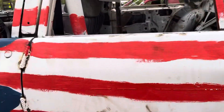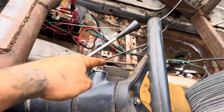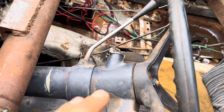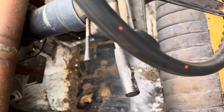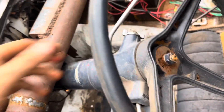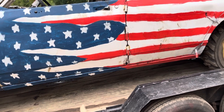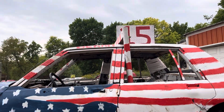The floors are actually pretty clean — this car is actually pretty clean for the most part. I was running into issues putting the new motor in — the driveshaft was hitting the top of the tunnel, so I cut where it was hitting and put some bars over to protect her just in case she tips over. I patched a little floor pan here — not that many rust holes but enough to want to patch it quick. We originally were going to run the stock shifter but decided to go with a floor shifter once we learned the motor was no good. She'll be running the number 15.